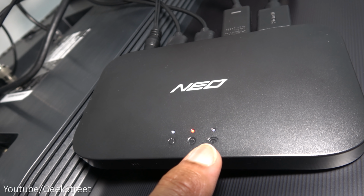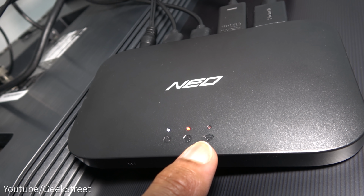So I've already registered, and you can see here it's already picked up the device, and the way it's doing that is via Bluetooth, as my Bluetooth is already on. So I'll click go to add, and now we need to add it to our Wi-Fi network, and it's highlighting here only 2.4 gigahertz Wi-Fi is supported. I've entered my Wi-Fi password. Coming over to the HDMI sync box, and you can see a light flashing. That means it's ready to receive a config.